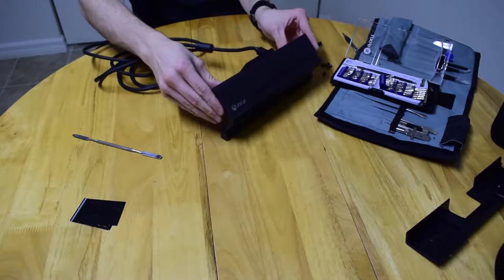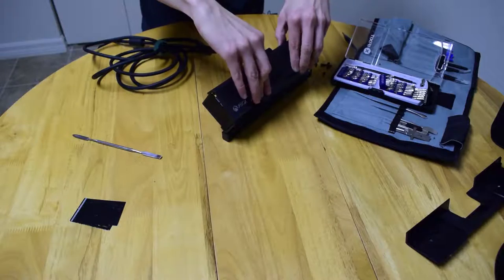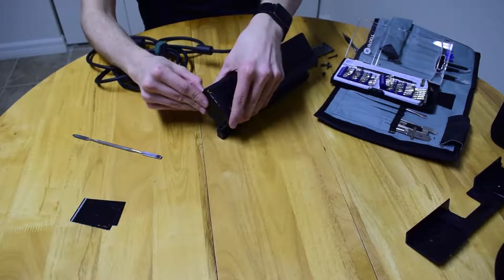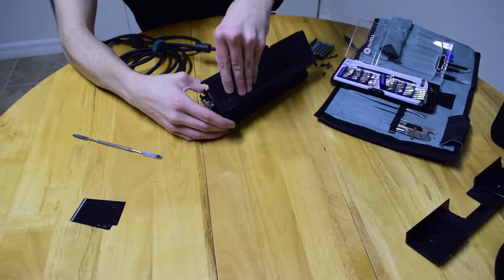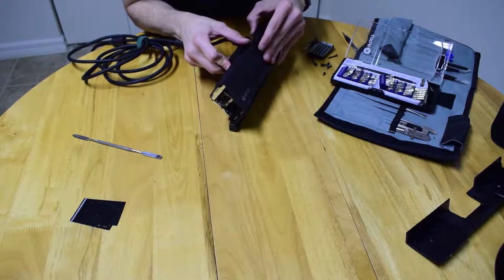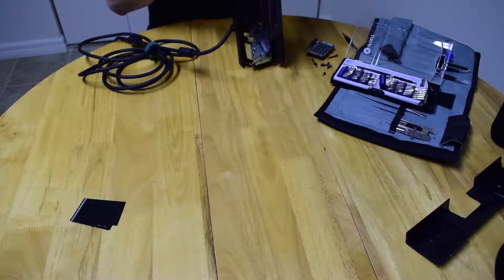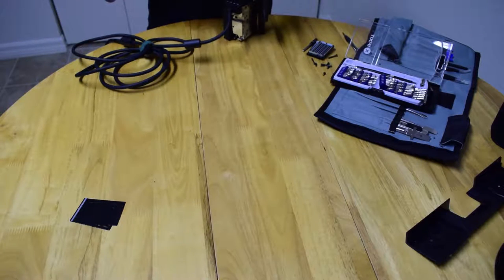Lift up on the back just like on the bottom side. The side guards should not come with it — they can, but they shouldn't. I'm going to remove those to get a little free space. I can see tabs in here. There's a plastic tab joining the top plate to the front plate right at the joint — it's maybe half an inch in. I can now see it goes through the metal plate, the heat sink chunk, and the EMI shield — there's a notch that's obviously for a screwdriver.